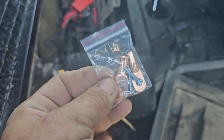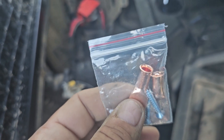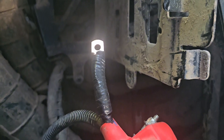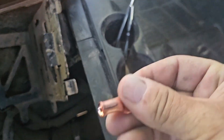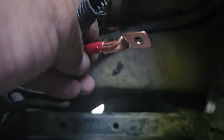As you saw before, it comes with these connectors. I'm going to cut those wires back to get those to fit on there. Not only will I crimp it, I will probably also put some solder on that and heat it up so it's soldered in there also. I've got the top one done. I didn't actually solder it once I crimped it down with some terminal pliers - it was in there really tight. So I put the loom back on it and wrapped it with tape. That's the one that goes directly from the battery terminal. Now I'm going to put the one on the bottom. When you cut that wire back, you want to cut it back about the same distance as the depth you see on this connector. Here's my wire - whenever you slide it over you can see that it fits down inside. I'll put that piece of wire back up in there before I crimp it down, then put the loom back over it and put some tape over it.